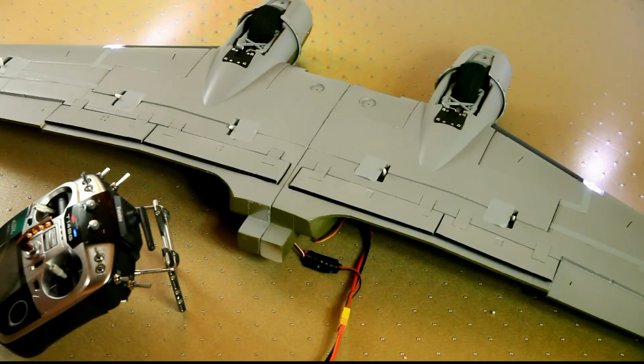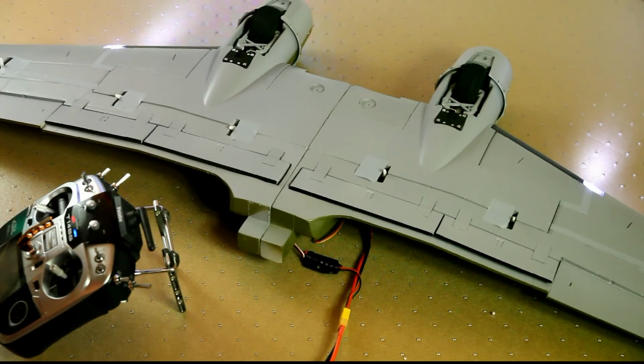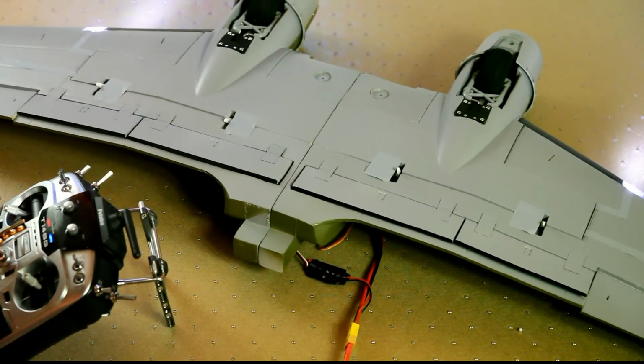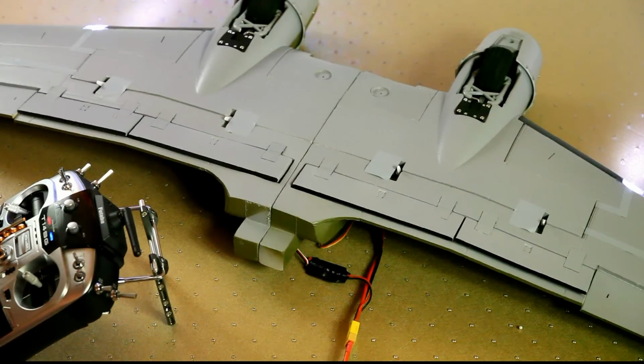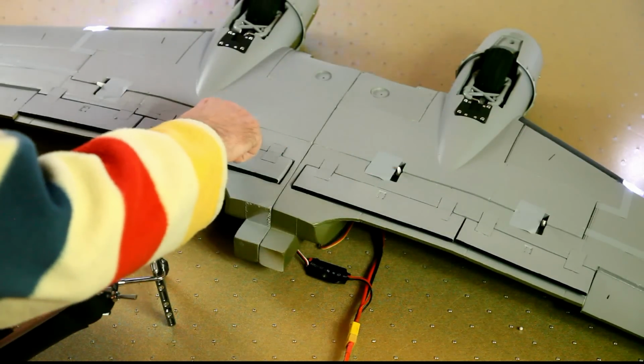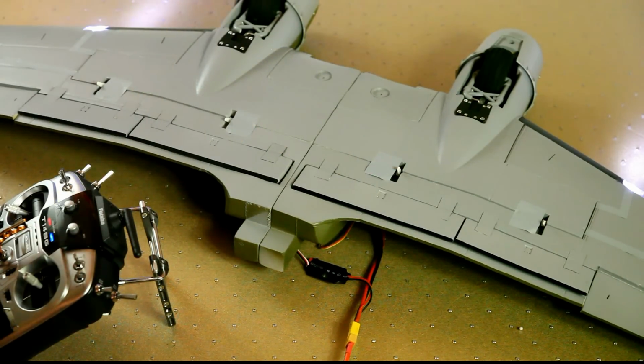Let me check in the viewfinder. I'm gonna zoom in a little. Refocus. Okay. I think you can see that this horn and this horn are completely out of whack. Of course I can make this control rod shorter, but then they will not function geometrically the right way. Okay, well, it'll be hard to get in there with a screwdriver.